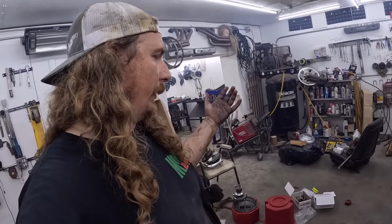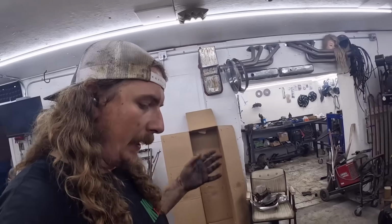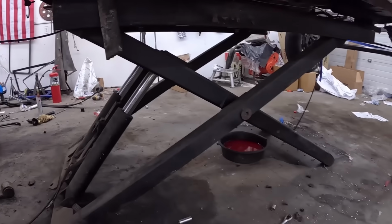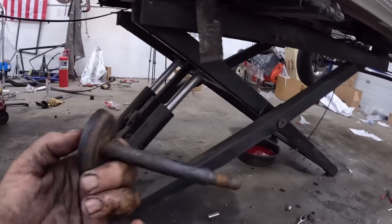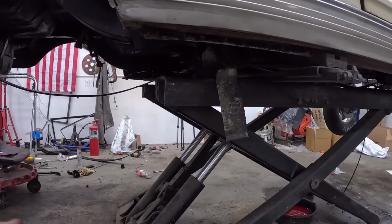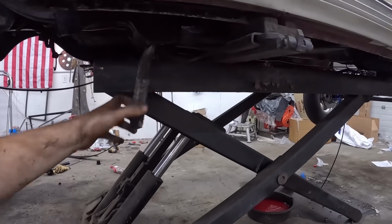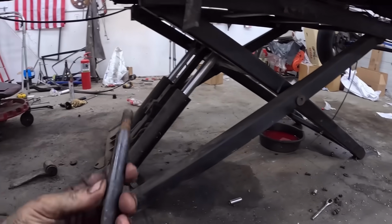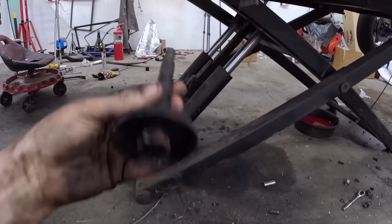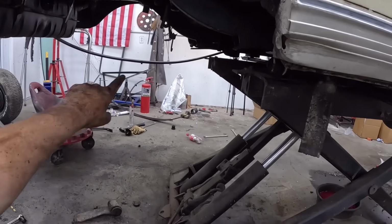So my plan was to just go buy some bolts and all that stuff, which I did. And I came back and thought I'd start putting this together. Anyways, I started taking out the rear leaf and I realized it's kind of a funny design. It's got this big washer, which ends up centering in the pocket and kind of holds it together. I'm like, can this come out easy or not really? Not really. It's probably half inch, then tapers down to probably a 7/16, and both came out, so I was like, oh, okay, well, I'll just reuse these, obviously. So I put the one leaf spring in.